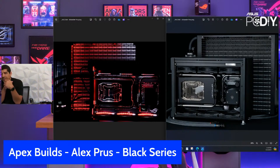Looks like the vast majority of the primary water cooling is going to be from Watercool. So the Watercool Heatkiller Pro with the heavy backplate. And then he's also got a Thermalright contact frame. That's for the CPU. The GPU is also the Heatkiller V Pro for the TUF 4090 ROG Strix TUF Gaming base cards. Radiator is also Heatkiller, the Rad S360. And then the Watercool MO-RA 420 external.